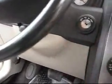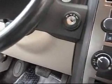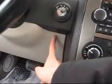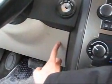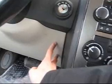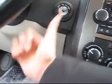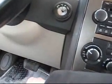So what I did was I just removed this whole panel here and tapped into the pink wire in the ignition. From here, there's a cable running down this side. There should be a pink/white wire. I'll list all the color codes on the side for you, so you can just read in the description there. So the ignition wire and power wire run through the firewall, and all this stuff is really easy to move, the paneling. It just pops right out.